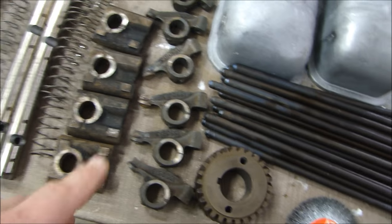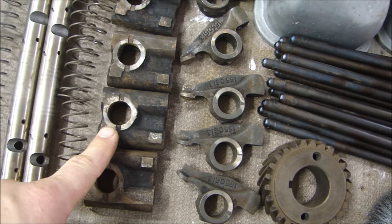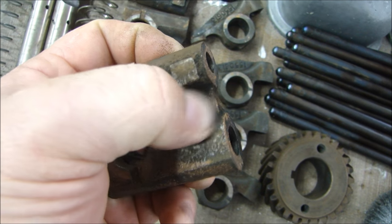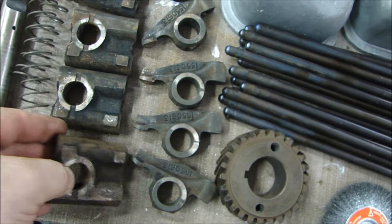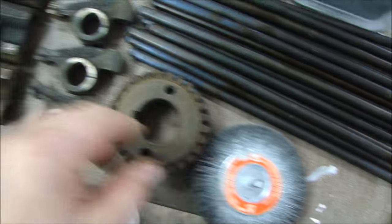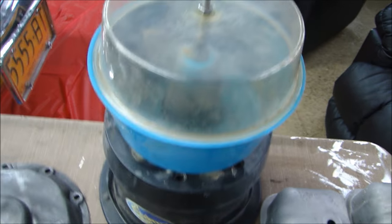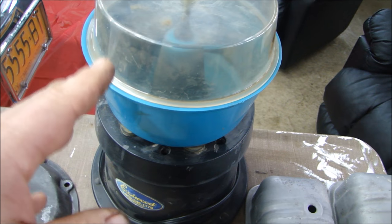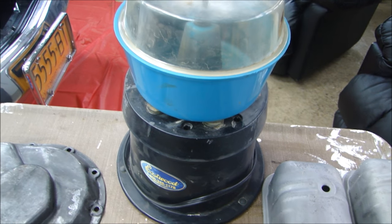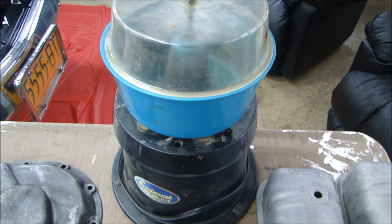This is how the valve covers came out after being chemically dipped and rinsed with water — that's how nice they come out. Now all I have to do is bead blast these so I can powder coat them. The parts that were in the oven for about a couple hours at 375 degrees — the reason you put them in the oven and bake them is to get the oil nice and crispy. It dries it out and makes it real flaky. If you don't have a blast cabinet, you can take it off mechanically with a wire wheel. And if you don't have a wire wheel or a bead blast cabinet, you can use a vibratory cleaner like this one I got from Eastwood. You can either use it to clean out parts or to polish hardware — those things work fantastic and they're not that expensive.